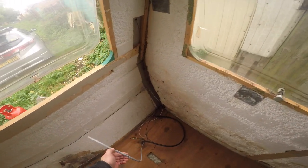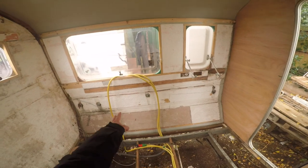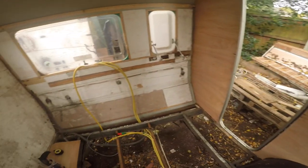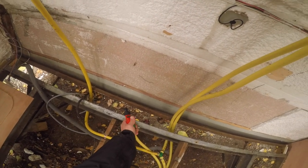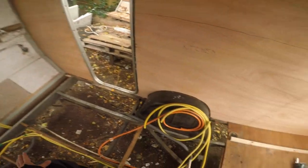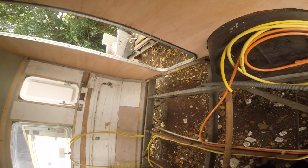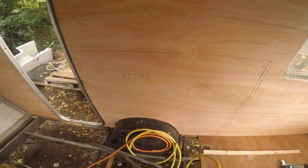This goes to the back and it's for the 16-amp socket. There are three hoses here. This caravan will have a water bottle in the front and an auxiliary water connection on the back. This has a valve here that you can open and close, so when the pump's running and water is coming from the front I could just close that and have one feed. This Y-splitter here — the water bottle from the front, the auxiliary connection from the back — goes to the pump water intake.